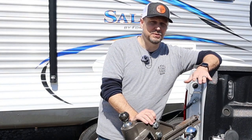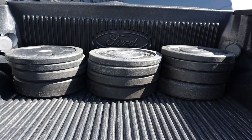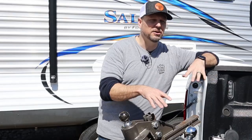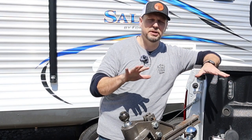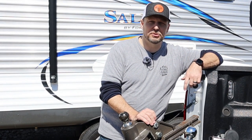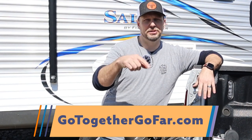In order to make this as even as possible with as few variables, the truck is completely fueled up, so there's no half tank of gas that may throw off the weight. I threw 280 pounds of bumper plates in the back of my truck to simulate having my wife and my kids in the car plus some gear. That will be exactly the same every time, so we should get a good apples-to-apples comparison of how much weight is being distributed. If this kind of information is helpful to you, I'd love it if you subscribe to the channel and click the notification button. For more information on Blue Ox hitches, I have a ton of stuff on our website, gotogethergofar.com, and I'll put links to everything down below.